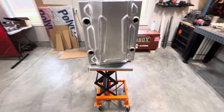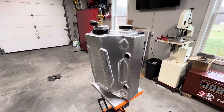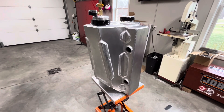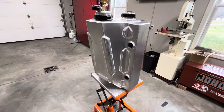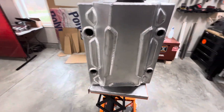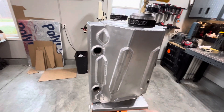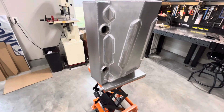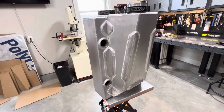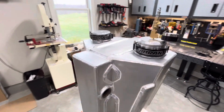These things run upwards of 100 to 150 PSI of boosted air going through them, and one side does get pretty hot. Everybody makes them this way, but there's such a big flat surface for that kind of pressure, so I went ahead and put weld doublers on everything, tied the bottom, underneath, and up top.